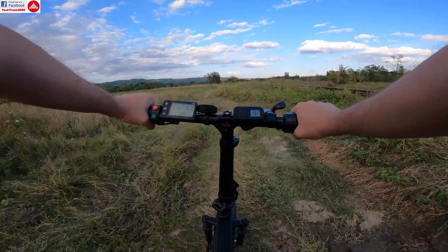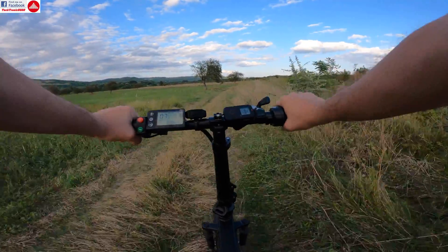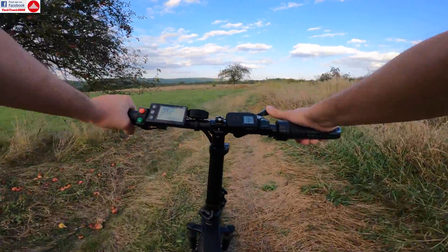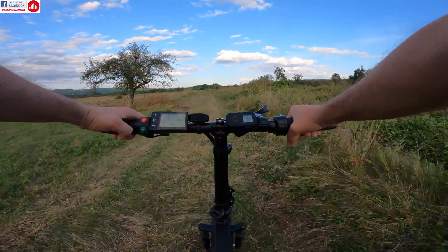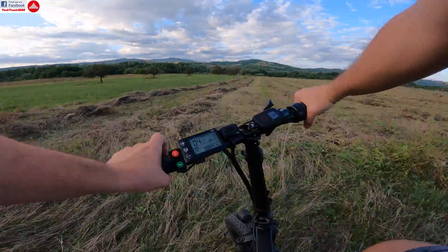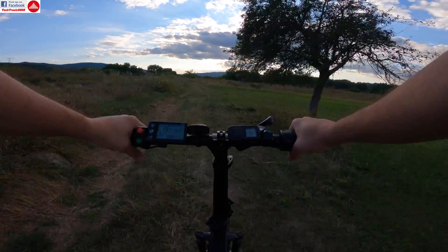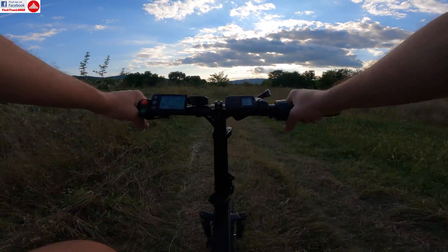In electric mode I can exploit this bike however I want — combine my pedaling with the electric throttle, give it more electric power, or pedal purely myself. I can drop into zero assist mode and pedal on a low gear. In the hybrid mode level one is more docile and takes me up to about 15 kilometers per hour; I'm ending the road here so I turn back. Level two in hybrid gets me to about 20 kilometers per hour — plenty enough.